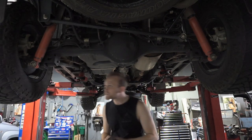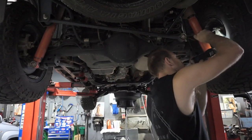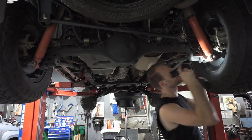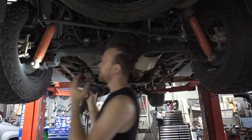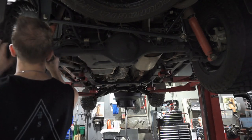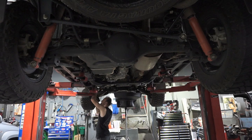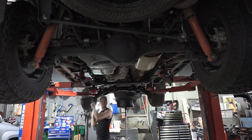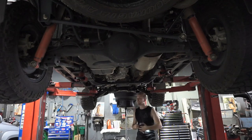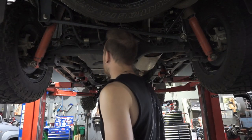So a little bit of a check on the brakes. I've just got a little inspection mirror here. I'll just pop that in there, and you can see it's about 10 millimeters on those rear ones. Then just make sure there's no obstructions in the brakes, like dirt, mud, grass, anything that could cause any damage, or the heat could light on fire. So if you've got grass built up around here, just give it all a good check over. Check those front ones. The thickness on the front ones is still about 10-11 mil, so that's pretty damn good for about 33,000 k's now. The front brakes are about 11 mil, the rear brakes are about 10, so that's a pretty good wear, really.